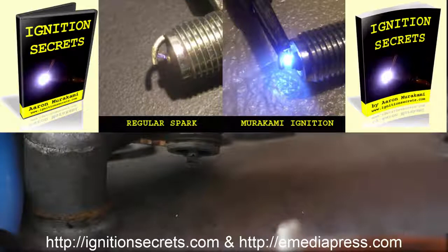So after that, that will conclude the ignition modification, and then we're going to be looking at putting on some hydrogen supplementation, tweaking the jets on the carb, because with this plasma you can actually run way leaner than the normal lean burn limits. 14.7 parts air to 1 part fuel is normal. We can go 20 to 1, 25 to 1, and we'll actually see the engine temperature drop, especially if there's a little bit of water vapor injection in there.